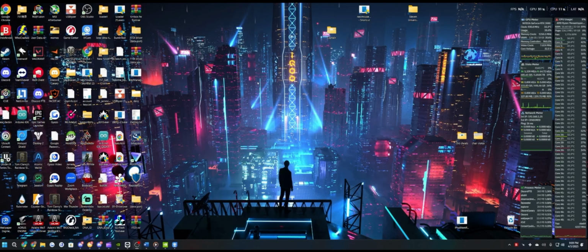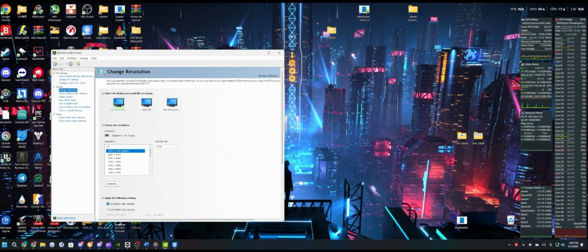If your screen is black and you are not seeing anything when connected to the fuser, I would recommend that you remote into your main computer from your second and edit the display settings, hertz, and resolution, possibly even pressing K1 and repeating the process of changing the hertz and resolution till you get a picture. If you still do not have a picture, the fuser that you bought probably does not support your monitor, and I would recommend buying another fuser, such as a D60.